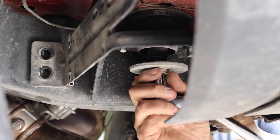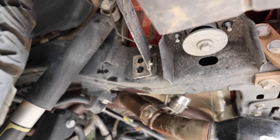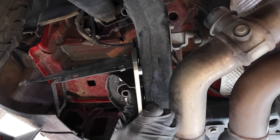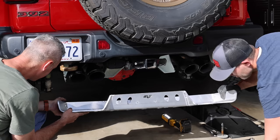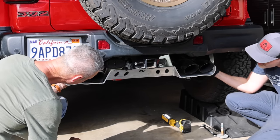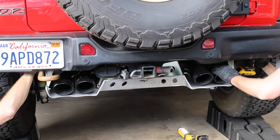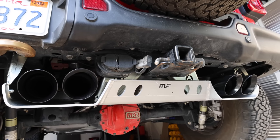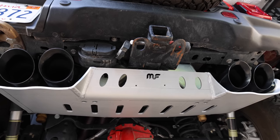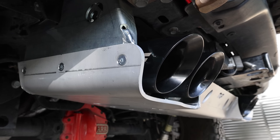It took a good bit of old-fashioned elbow grease to get these body bolts loose. There are two other bolts just next to them that need to be loosened — that's where the side muffler mount actually attaches. Once you have clearance, the bracket can be slipped into place and bolted up, and then the muffler skid plate can be bolted right up. Oh yeah, this fits nice and tight and should prevent me from banging up these exhaust tips again. I'm sure there's some grumpy person out there commenting that these exhaust tips are too low or they're only meant for taking your Jeep to the mall.